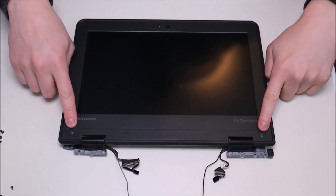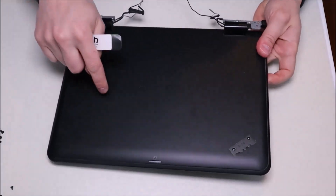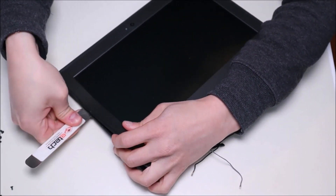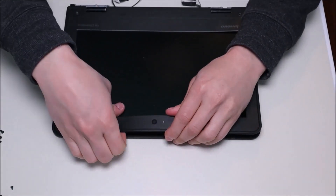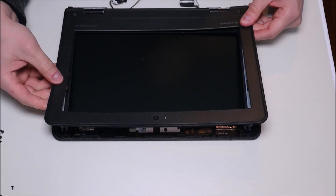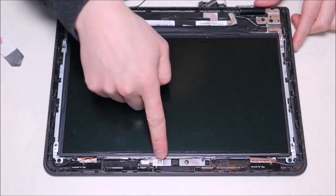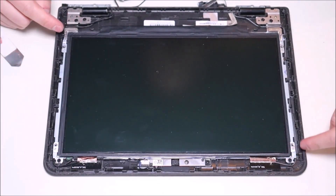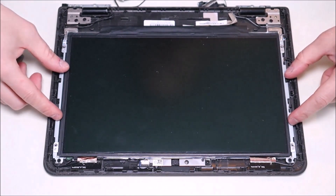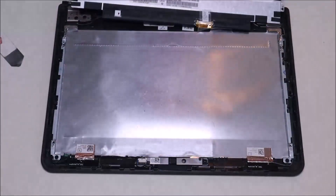Here's our LCD assembly. There will be two screws there underneath black stickers. We're going to take our flat metal pry tool, go around the seam of the bezel and the top case, and pry those apart — be careful not to put your tool too far in as you don't want to damage the LCD. A lot of these bezels are held on by double-sided tape once you get the screws out, so just go around and release it — try not to crack the bezel by folding it too much. Here we have your LCD, your webcam, your antennas, and your hinges. You'll have two screws here and two screws here holding the LCD to the hinge assembly. After removing those four screws, you'll be able to lift up your LCD, flip it over, and unplug it.